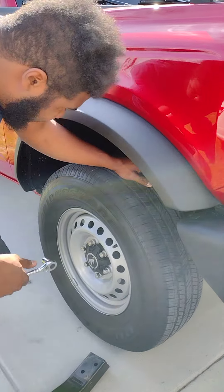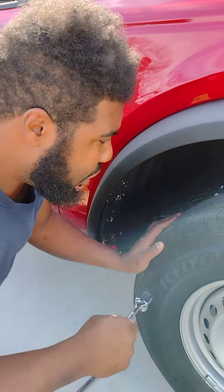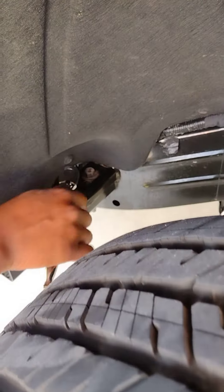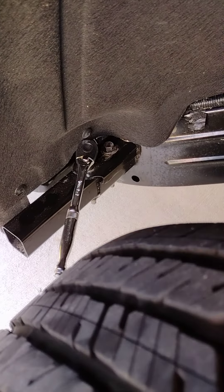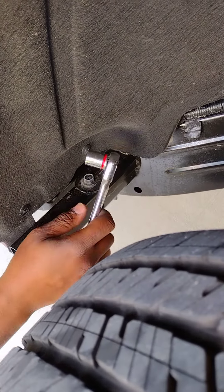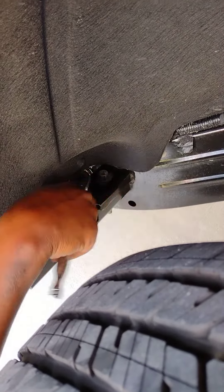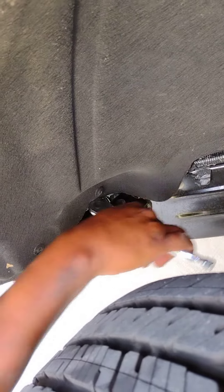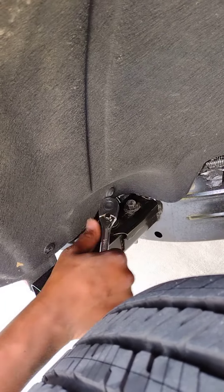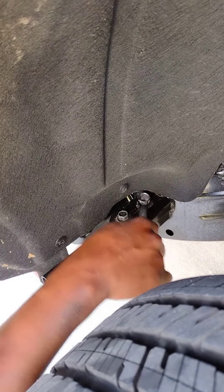Front is gone. It's the same way for the rear, but on the rear you don't have to worry about the bumper, so if you want to put the bumper back on you can. This is where it gets interesting - the front bolt is always easy. The wheel liner gets a little in the way but it's nothing terribly bad. I don't want to remove the wheel liner just to take out one bolt. This is where it gets not so fun.